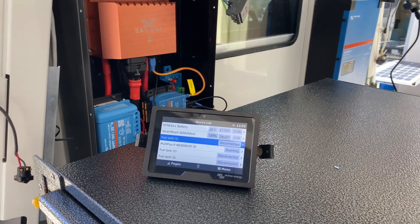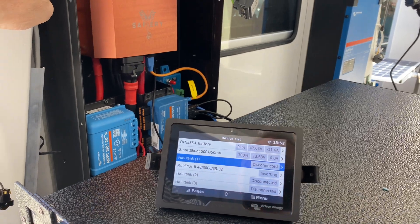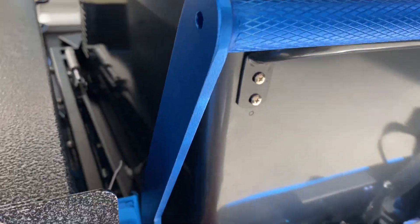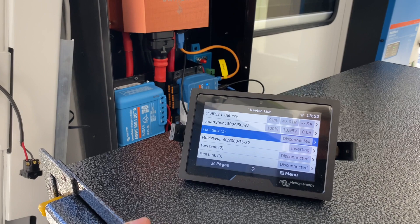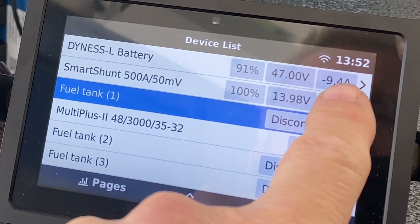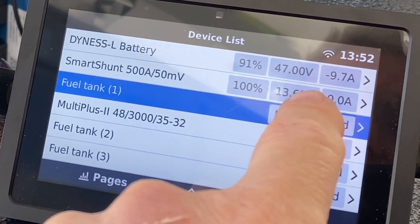Hi, Bruce from Safari. We're having a look at Scotty and our 4812 hybrid in this Ford Ranger. We've got the fridge running at the moment, and we've got the 48-volt batteries underneath. What we're demonstrating here is the on-road and off-road mode for a DC-to-DC, and right now the power is coming out of the 48-volt batteries into the 12-volt starter battery.